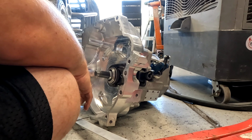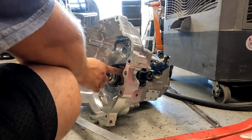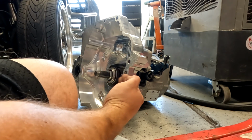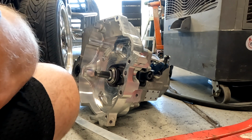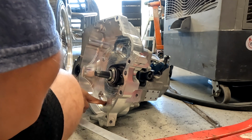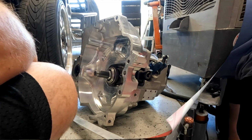So we need to pull a 1/4 inch off of the spacer. Which does make sense because we pulled a 1/4 inch off of the plate. I mean, I understand we could always shim the pivot ball. You can bring the pivot ball closer or farther away. I just don't want this bearing to constantly be rubbing on the actual diaphragm so it wears out that bearing prematurely. So if I can put a 10-20 thousandths air gap in between the bearing and the plate.